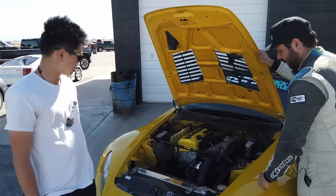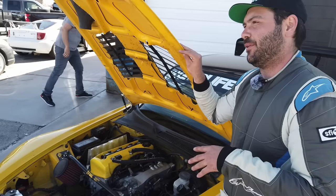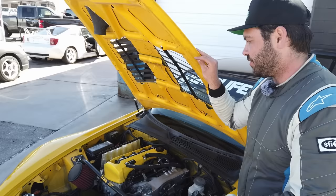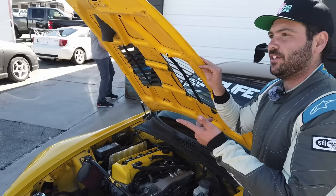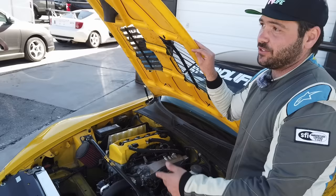The suspension is Feal 443s. They're Feal with Penske internals and Penske canisters. So it's a Penske three-way canister, but a Feal body. Okay. And then the three-ways, I worked closely with Odie to get the car set up, and we had to spring up the car from where it was NA to 20K front, 18K rear. For an S2000, it's a lot.